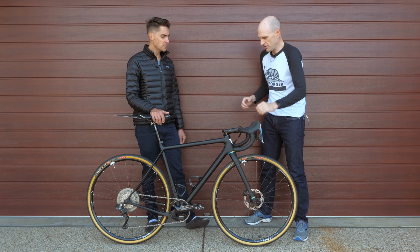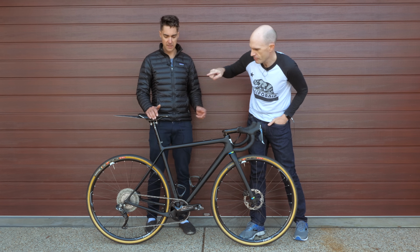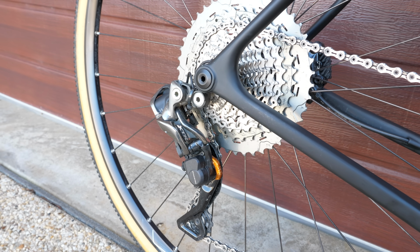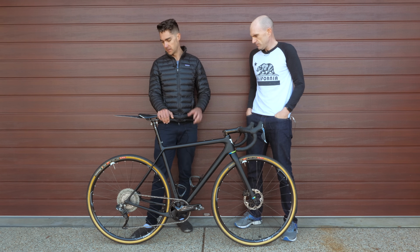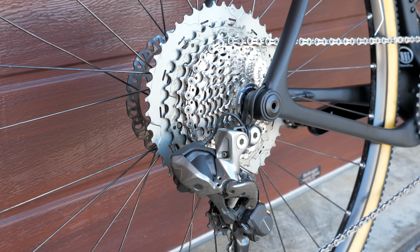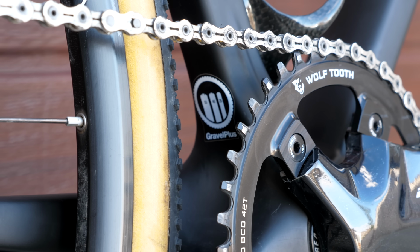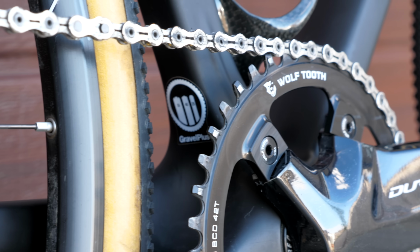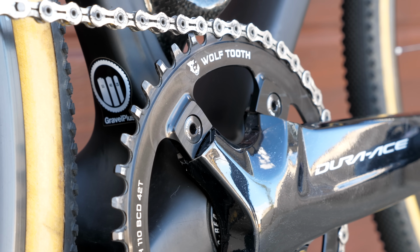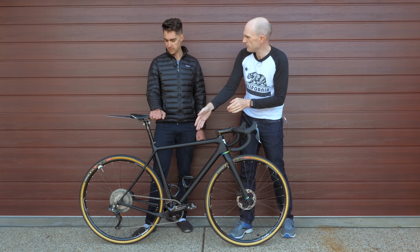Okay, so road style, obviously not mountain bike style shifters, they're road shifters. Yep. But to make it all work, and it's kind of why I went with Di2, is the derailleur. That looks funky. It's a mountain bike XTR derailleur, a Di2 one as well. That gives me the range, with a 46-11 cassette. 46 at the back. Now, you've got the massive range because you only have one by on the front. Yep, so I did away with the front derailleur and we have a set of Dura-Ace cranks with the chain rings off and a Wolf Tooth chain ring, a 42 tooth 1x chain ring on the front. So group set in summary: road levers, road cranks, custom Wolf Tooth chain ring.